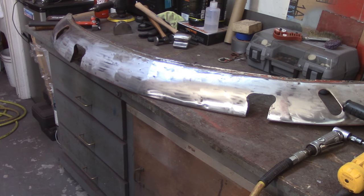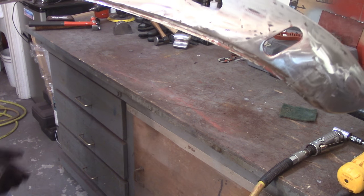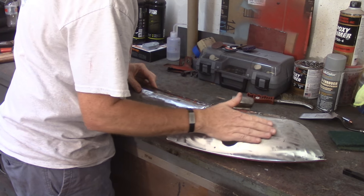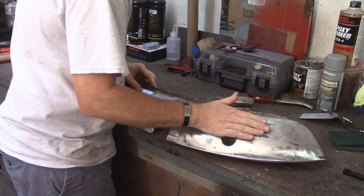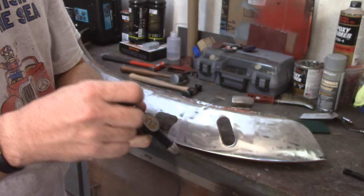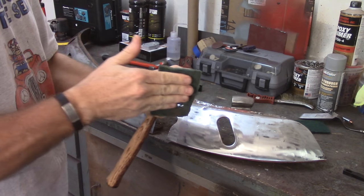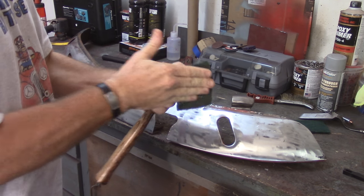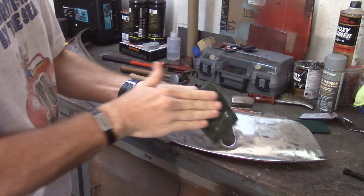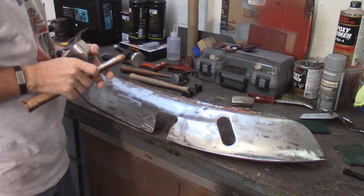All right, now that's kind of done, clean enough. There's a good low spot right here, probably mainly because of my welding work. The face of these hammers gets pretty dirty, and I like to take that stuff off — one, just to keep the hammers nice; and two, because when it starts to matter, some of that material will get imparted into the panel, especially if it's thick heavy stuff. So I'm not going to stress over it too much, but I don't have big chunkies on there either.